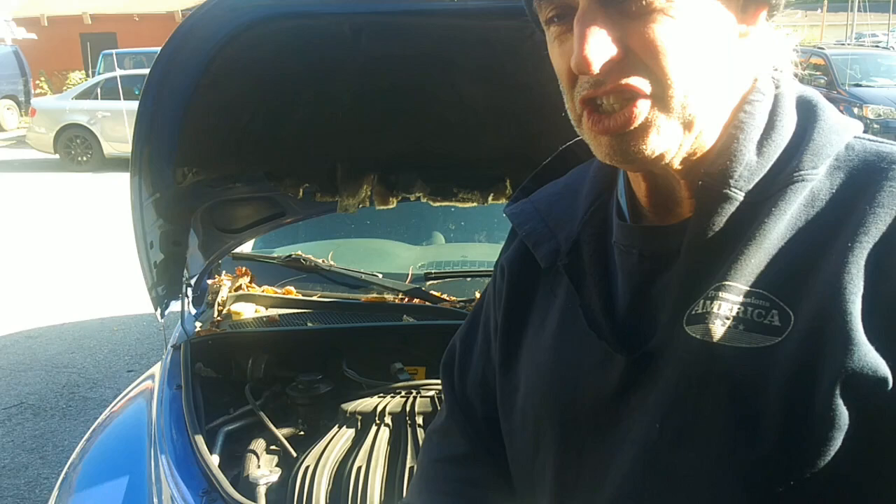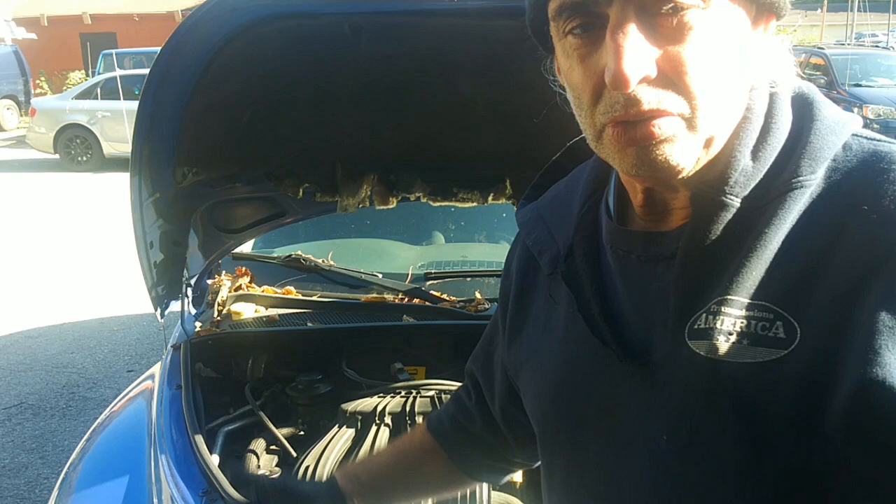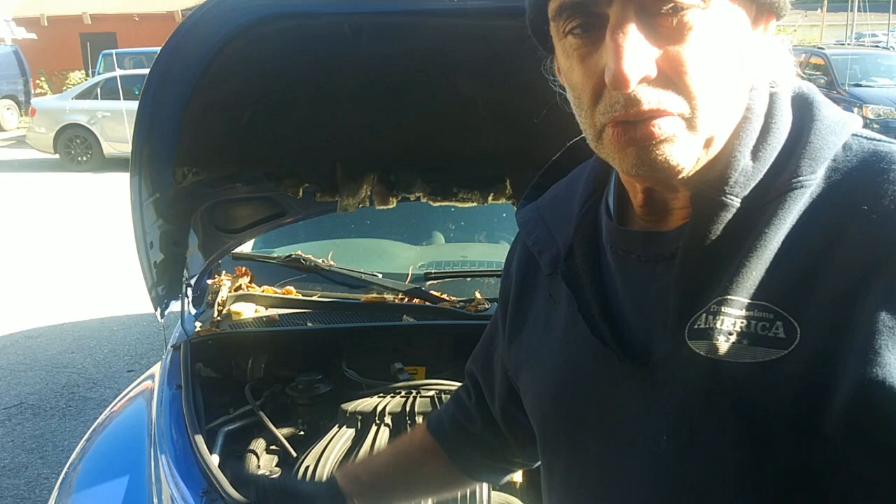It has more power. When you find stuff like that, that's like scratching off a winning lottery ticket, man — that's like money in the bank. So what we're going to do now is take that wire harness, move it out of the way, clean it up real good, get it where it's not touching the bracket anymore and it's insulated really well. Then of course we're going to reset everything, clear the codes, and give it back to the customer.